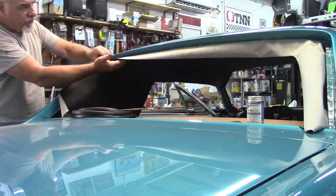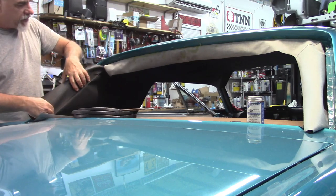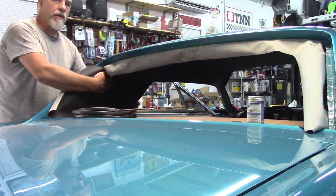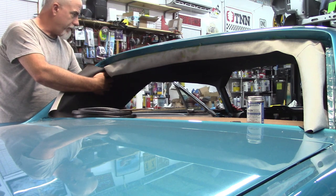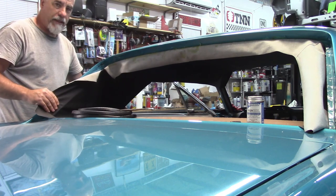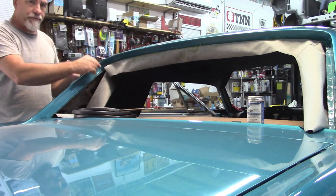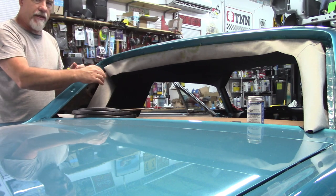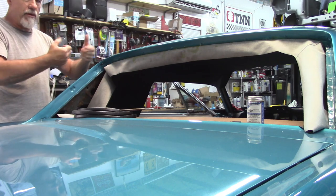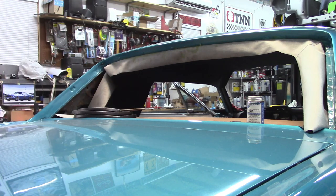I want to do a little at a time until I get comfortable with it because all this is going to have to be trimmed off as well. I've got to get this piece around this edge, but I need to manipulate the inside first. I want to start there, get this front edge set, and then I can pull this away from that and it will help tighten things up. I'm going to make a cut the same way on that side. I've also put marks on the front where the windshield corner is — I'm going to cut that as well because as I'm pulling on it, I need to have some relief. I don't want something trying to pull away from the front.